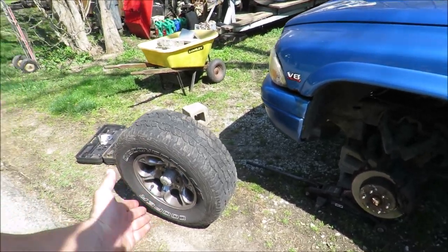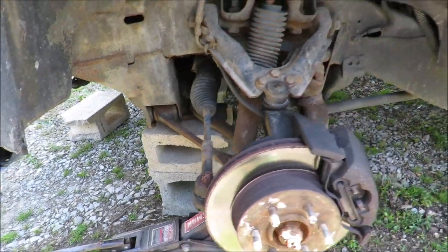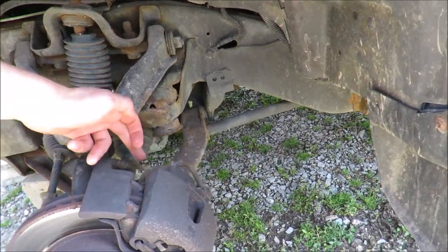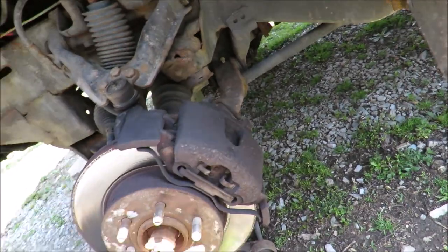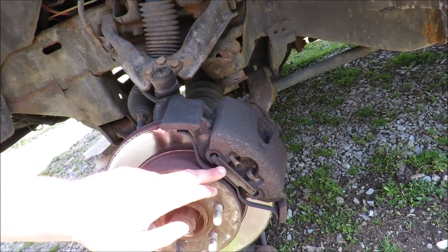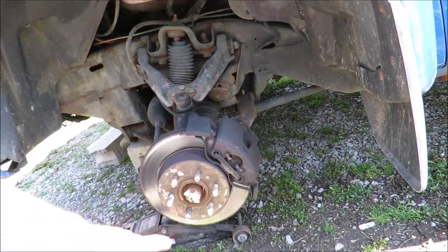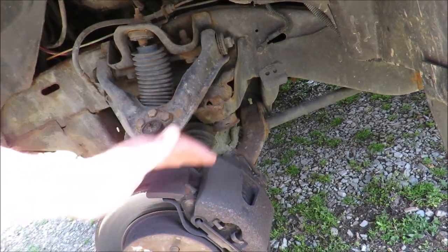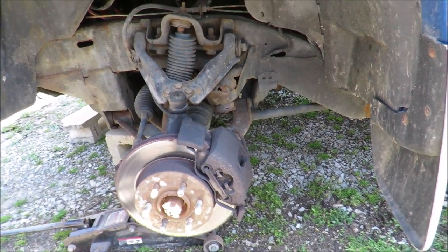We finally got the wheel and tire off and we got the front end up on some blocks to keep it stable. We'll pull off the other side too, but now in order to get the caliper and rotor off there's one bolt up top — a seven millimeter Allen — and then one down below. Then you use a big flathead screwdriver to pop out the clip that'll separate the caliper off the rotor. Then we can pull the rotor off and hang up the caliper somewhere, making sure we're not hanging it from the brake line. Then we'll clean it up, wire wheel it, and prep it for paint.